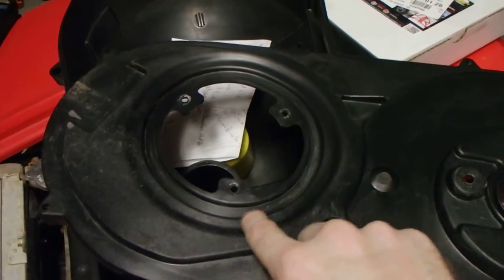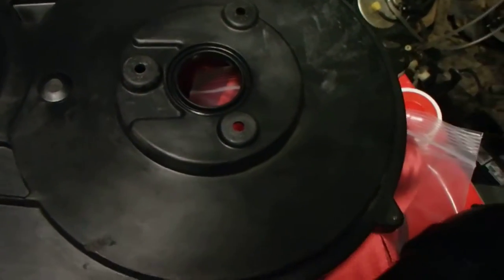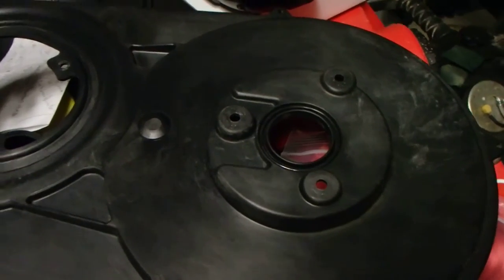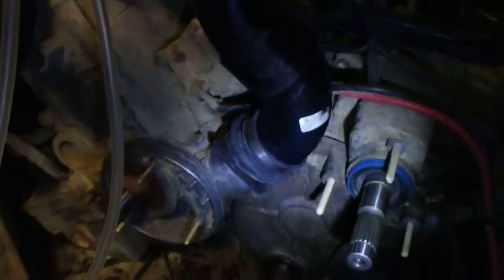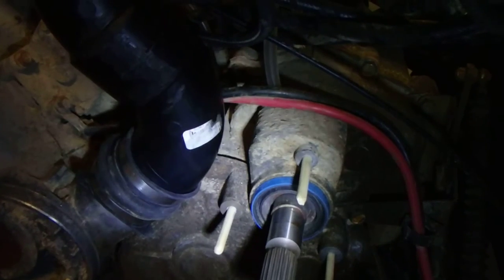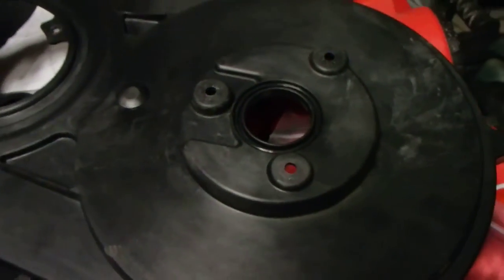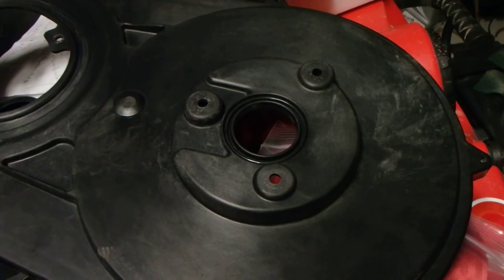That's not the hard part. Laying a fat bead of blue RTV all around here is going to get the job done. But this other side, I'm not very confident with. Some people are putting gobs of the Right Stuff or other sealants on here, but the problem is this side actually lines up with a bearing. This bearing seal is interesting — it has an outer part that's blue, an inner part that's black, it's got a couple lips. And all that is supposed to basically line up with this inner ring and hold all the water out. But this is a 2017-year-old machine and I'm not confident that it's fitting very tight — it feels like it's got a little wiggle room.